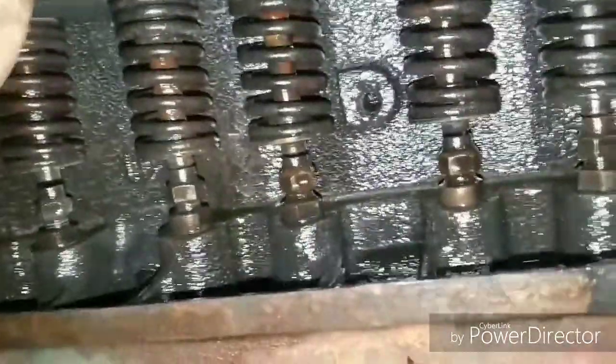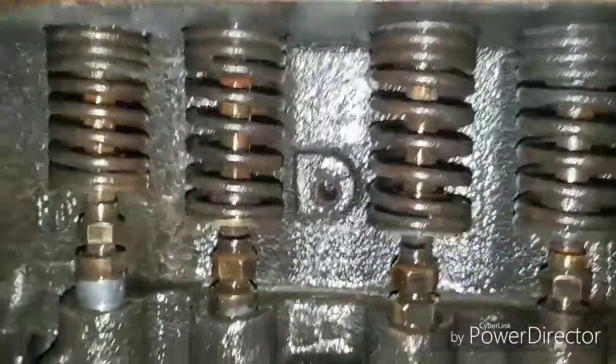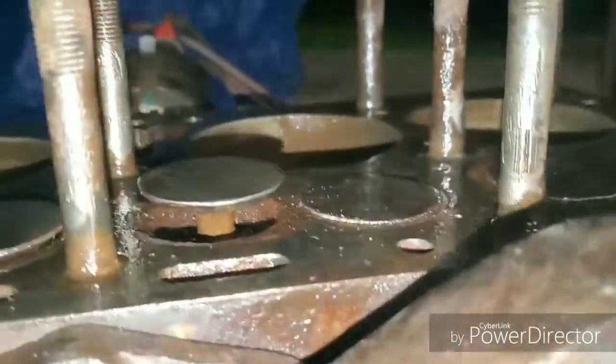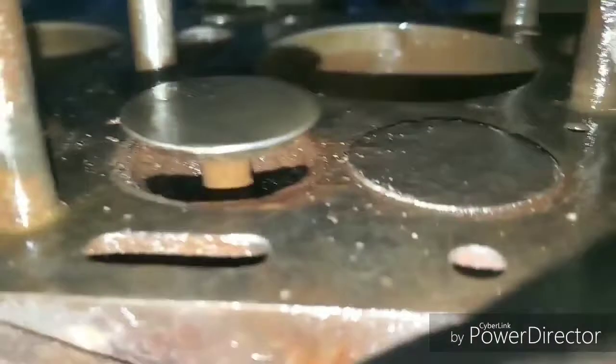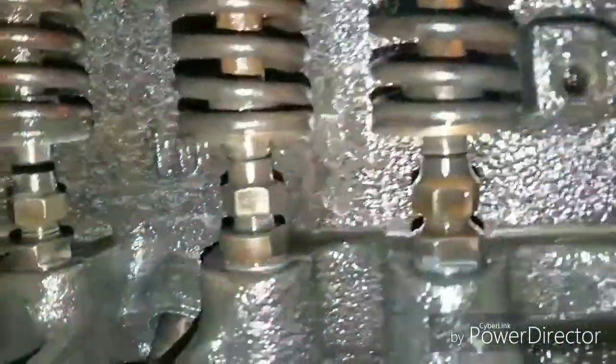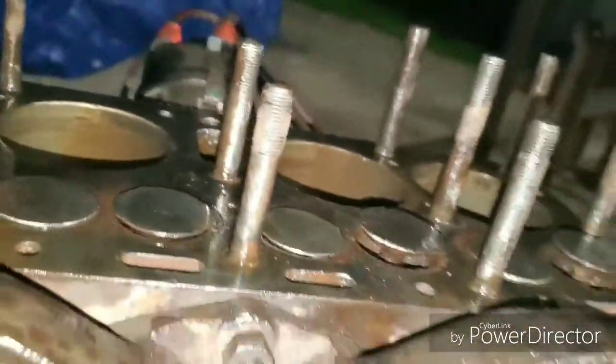Come on now. I guess what I could be showing you as well is the way this works is, let me get back on this bolt here. And it's starting to go. Dang it. Alright. See, and that's the lifter for our stuck one. There's our valve open, which it was stuck open. So we know it can do that. What we want to do is make sure it closes. Oh, it's going. It's going. And it went. Look at that. That's closed. All of our valves move. Again, hell yeah.